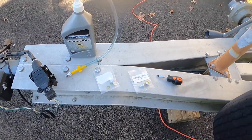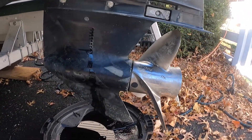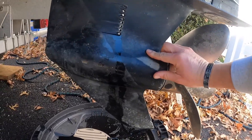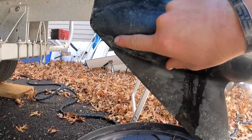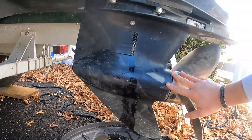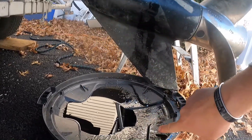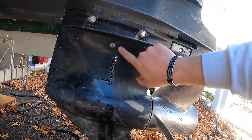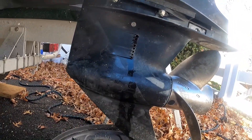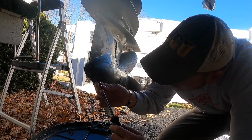I already did one side here. Down here you've got two screws — the upper one and the lower one. The first thing you're going to do is tilt your motor down, put a pan underneath or a trash can lid. You're going to unscrew the lower one first, then unscrew the upper one to allow some air in there so it flows out a lot quicker.